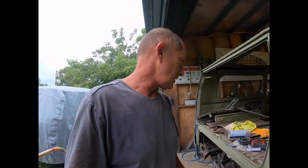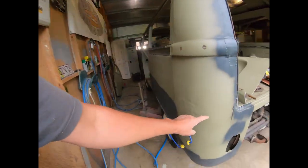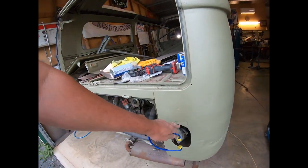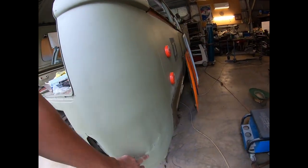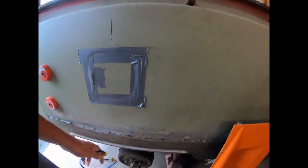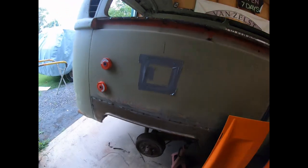All these patches have been put across there. After doing full-length back quarters before, if you can get away with patching them if they're not too far gone, these ones are going to need a bit of panel beating. The main thing is that the rust is sorted and you've got it all treated up. This one needs to be welded up — that's all got to be knocked out and weld the holes. I've done the same on this side, so that's tacked in place.